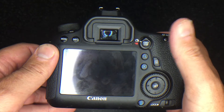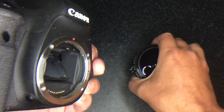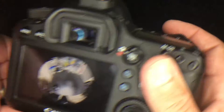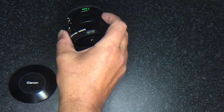A 6D, which has the same mirror as a 5D Mark II and a Mark I — as you can see, the mirror is stuck and it doesn't open all the way. So if you want to use it, you need to bring the mirror up first, then mount the lens and you can shoot. If you were to put it down, it's not damaging the mirror or anything, it just doesn't go all the way down. So to remove it, you would have to remove the lens and then bring down the mirror.